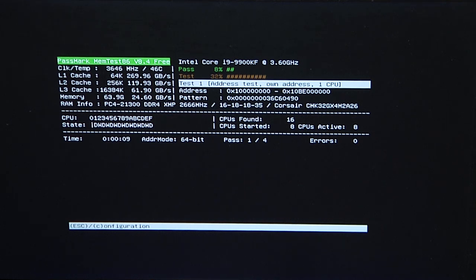Once you're happy with your setup, it's best to move on to a stress test, making sure you don't have faulty RAM or CPU. Memtest usually takes 12 to 15 hours to do a full test. It's best to do it overnight. If everything passes, the PC is ready for your operating system of choice.